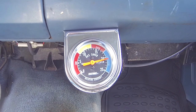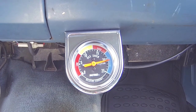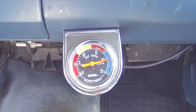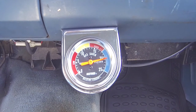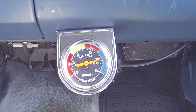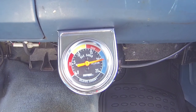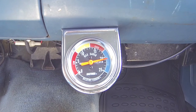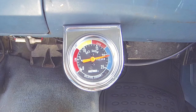But I can watch this. You see the way the needle's like quite solid? That's good. If it were bouncing around too much, especially if it was bouncing between the excellent and the good range, you can tell the engine's going to stall. If this is too dynamic, you can tell the engine's not happy or not pulling a full, complete vacuum. So if we were in gear and driving and it was in excellent mode there, I would be shocked. Obviously, the more that you have the throttle open, the less vacuum that you have because it gets consumed by the engine. So yeah, I wasn't sure how much I've shown that before.